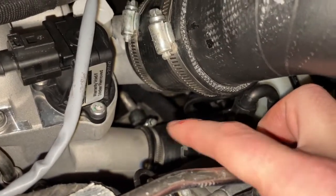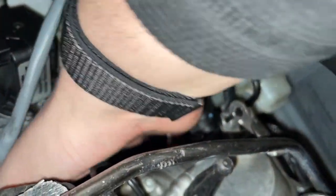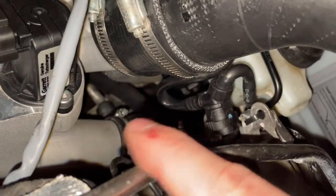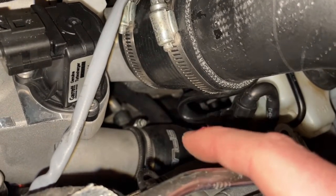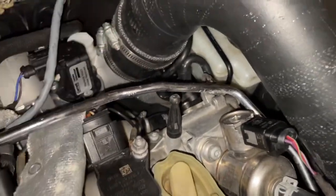There was too much wiggle room, so when it actually closed it was bending and not sealing — it just had too much area. I thought it was where the charge pipes connect, but that's actually very, very close to one another. That's my charge pipe where the turbo charges the air down, and that's the spooling coupler — no movement from that one. The only movement I found was the intake portion. It all made sense.